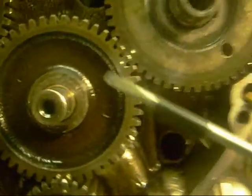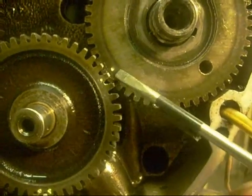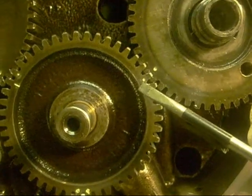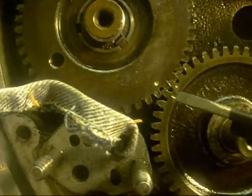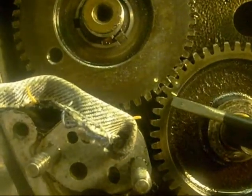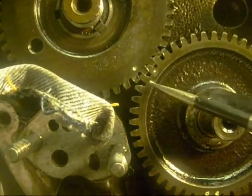This is a T120R, and you've got your one dot on your exhaust, and that goes to the one dot on the intermediate pinion. Then we have a choice: one dot on the pinion, plus a little dash. For the T120 you stick the dot opposite the dash.